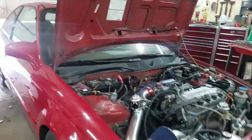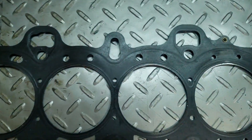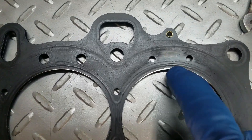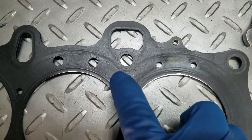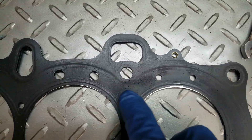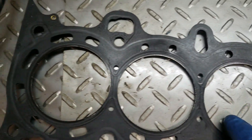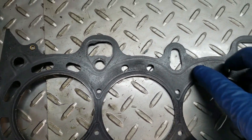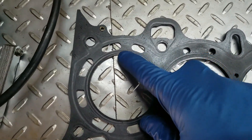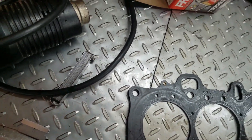I got this all put back together. These firing rings are a little blown out. This one's got some funny stuff on it — I don't know if it's carbon buildup or what, but it's all over the head gasket. I think it's carbon from the head lifting. Yeah, all these firing rings are kind of blown out a little bit from the head lifting.